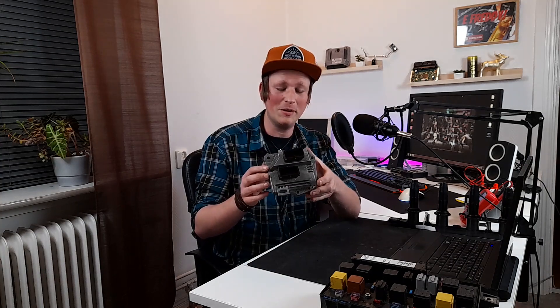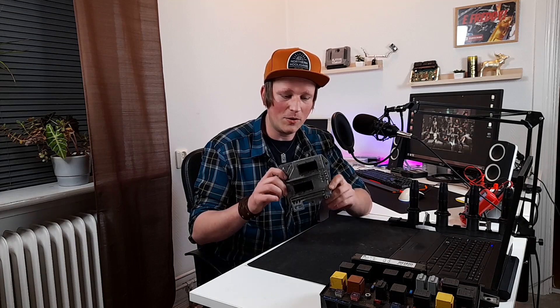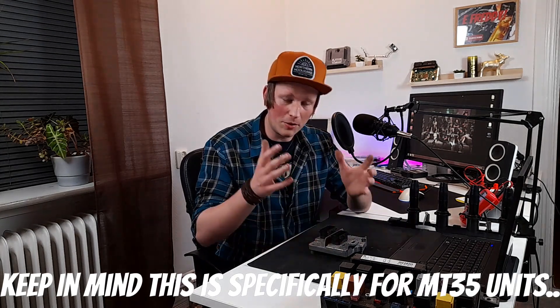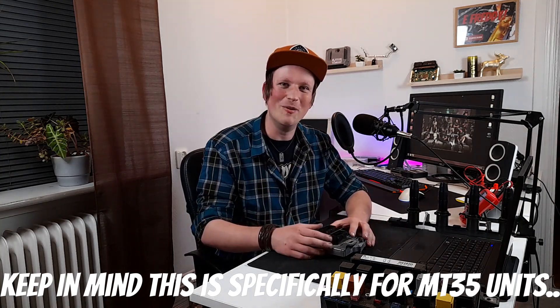Hey folks, my name is Freddy and in this video we're taking a closer look into this ECU unit I have in front of me. This is the Delphi MT35 unit and in this video we're going to talk about how easy it is to make a faulty diagnostic about these units. If you have the P1600 fault code stored, it's usually stored inside the ECU itself, but in almost any cases it points to an external hardware issue somewhere else in the vehicle, so stick around to learn more.